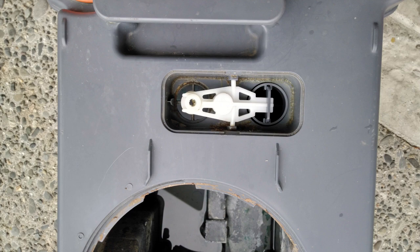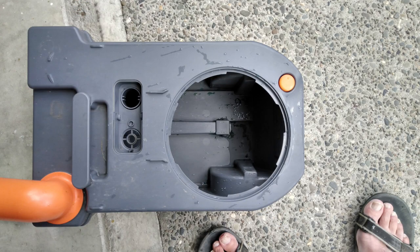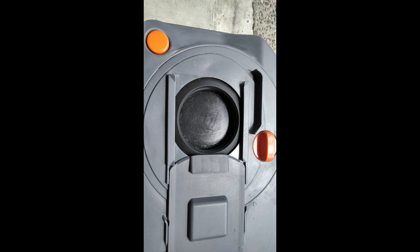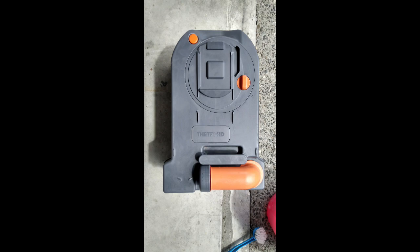That is the overflow, and it does need cleaning inside. It's very simple — just prize it off with a screwdriver and give it a good wash and clean. You can see the inside of the tank has come nice and clean, back to almost brand new condition. It was not that easy, but the scrubbing brush and CLR works very well. There's a small magnet on the end of the float that I clean to make sure it gives contact and switches the light on top of the Thetford unit so you know when the tank is full. Now it's all gleamingly finished, and I use silicone spray around all of the rubbers — there are no leaks in the tank and no smell emanating from it at all.